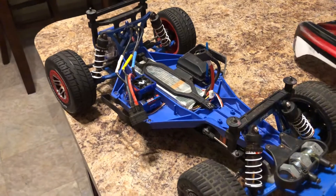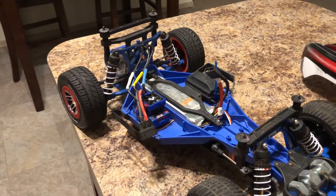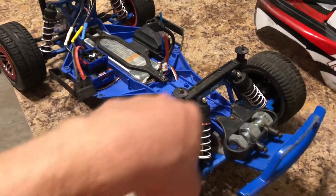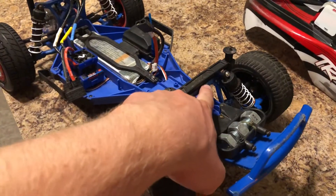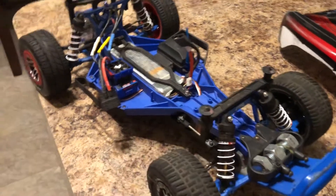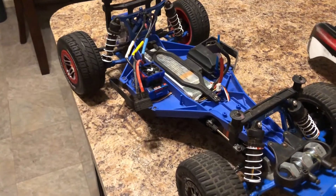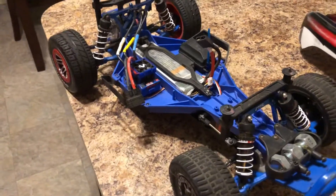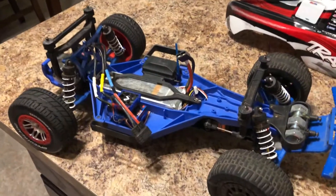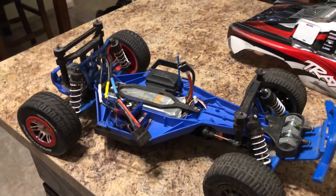Overall I'm really happy with how the car performed. We're going to go sometime this week and test on the indoor more technical course to see how it does. On the dirt oval it was literally probably ten times better than before. The STRC shock towers really help stiffen things up versus the flexible plastic stock ones. Next I want to play with the gearing more and my shock oil, and figure out what the local people run. This is probably one of my favorite cars to drive — my Slash two-wheel drive.